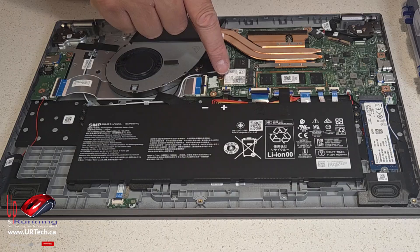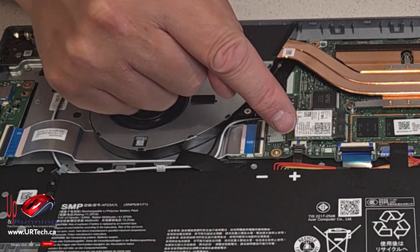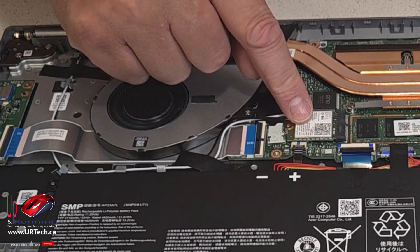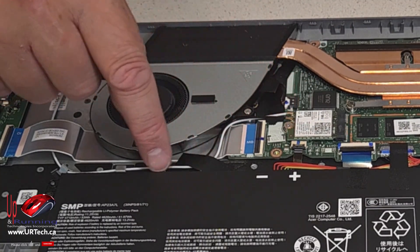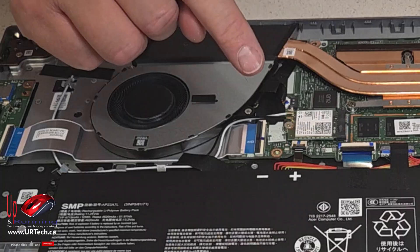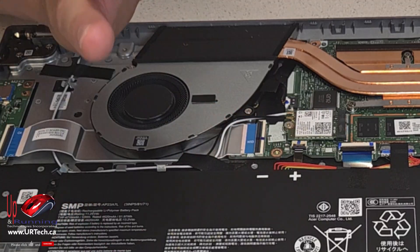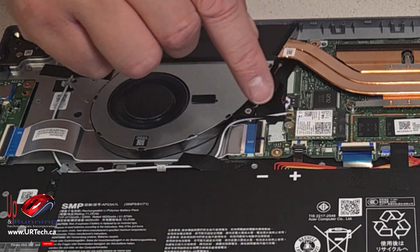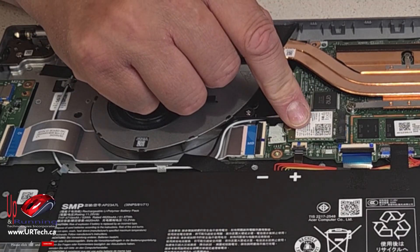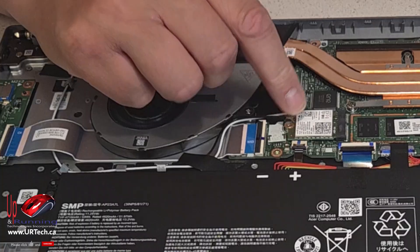That is your Wi-Fi card, and this isn't just regular Wi-Fi — this is Wi-Fi 6E. It's in another M.2 slot so you could change it in the future, but you're not going to because this will be the standard for a long time. Two antenna lines: one goes behind the keyboard, one goes behind the monitor, so no matter how the laptop is placed the antennas will pick up the signal. Wi-Fi 6E — the 'E' stands for enhanced — runs on the 6 GHz band, which means it'll run much smoother with very few competing devices on that frequency. It's the latest thing and it's really great.